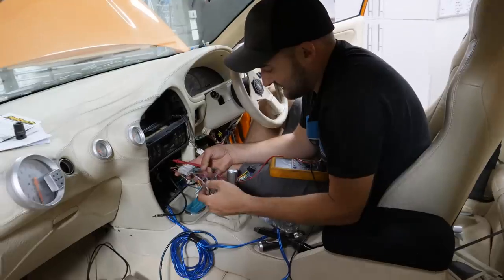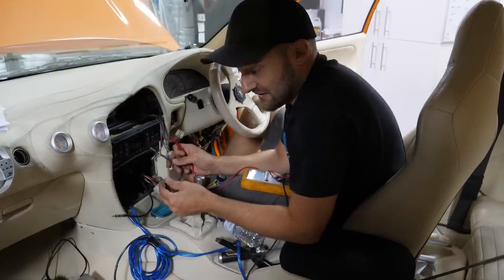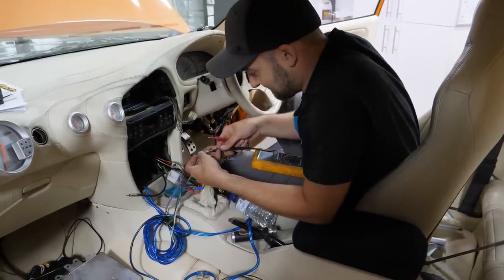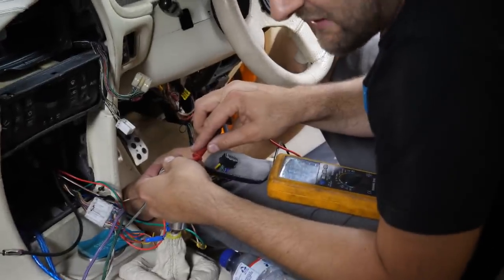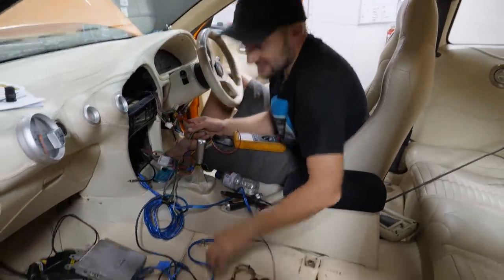Yeah. So I think possibly once upon a time they were connected to the head unit, and maybe they're not anymore, but we'll be able to find this out as well using another trick. To see if there's any sort of continuity across the coil of the speaker. So if we do that and that, positive, nah, there's nothing. So hopefully those speakers are wired directly to this amp. Yeah. If they are, we're in luck because all the circuits will be complete.